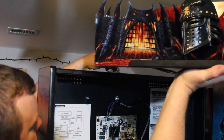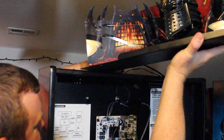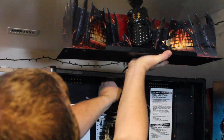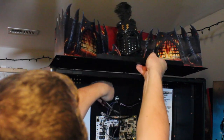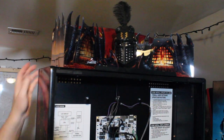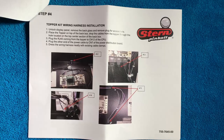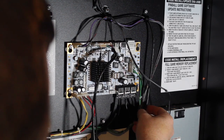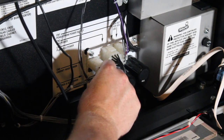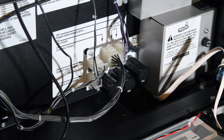We gotta carefully run wires down, not hit your ceiling fan. Ethernet cable's going to CN12, and then we've got the power connection here, so we need to route our cables down. All right, there's CN12. That didn't leave us a lot of room to work with, but we go down to CN7 on the power board down here. And it's a keyed connector, so you can't mess that up, but yeah, you gotta kinda run the power not as cleanly as I would like, but good.